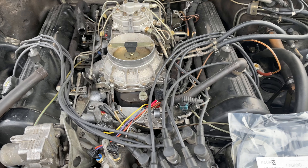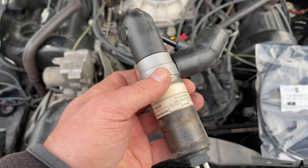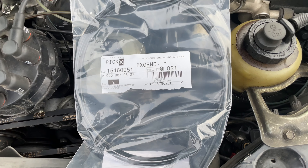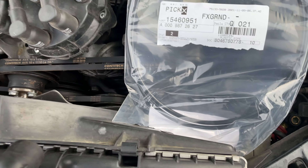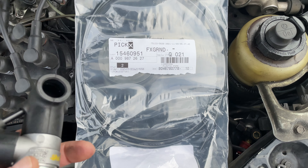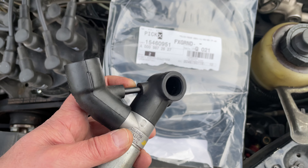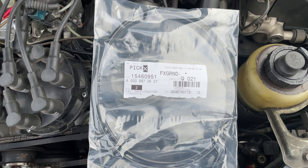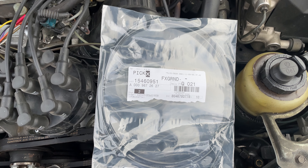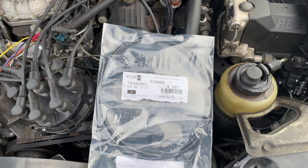Good afternoon. I'm going to put in the modified idle speed air valve, which is this here — the one I had in the video. I put my connectors on here and the rubber hose. I got a new piece of this plastic connector; they sent me six feet of this stuff. I will send you a piece made to the correct length, which is 42 millimeters — one and five-eighths inches — for three dollars. I'll put my Cash App in the description of the video so you can send that to me. Please put your address in there so you don't have to buy a whole spool.